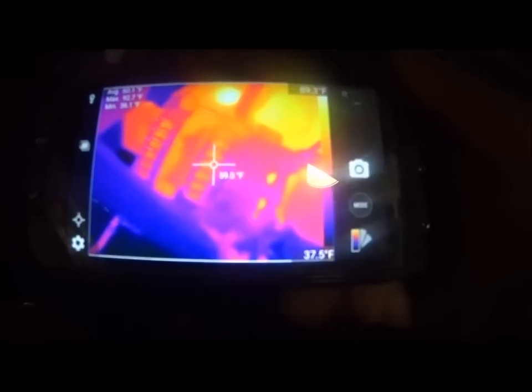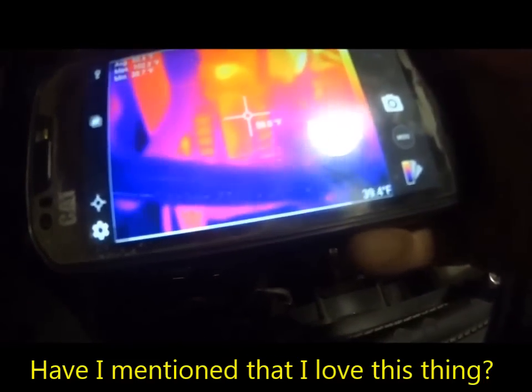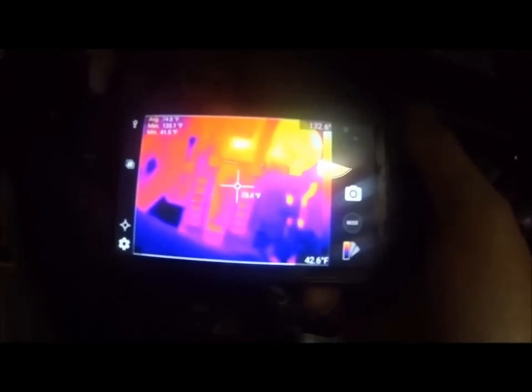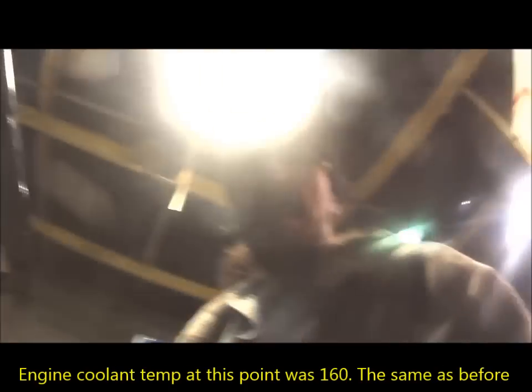As you can see, we're not overheated — it's a good thing. It's not burning up any longer as it was. That thing was scalding when I took it off. We've had this running for a little bit now and I wanted to show you the difference — they were at 70-something degrees. So there's a big difference between 200 and change, almost 300 degrees versus where we should be. It proves that thermal imaging is great for verifying things or quick checks — you can obviously see if an alternator is getting that hot, we have a problem.